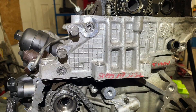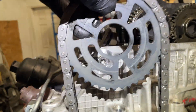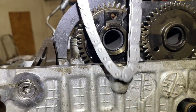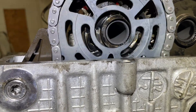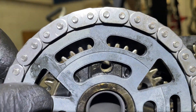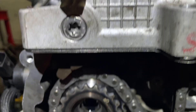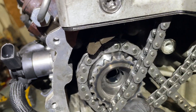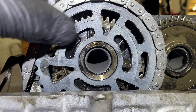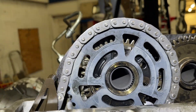When it comes to putting this top sprocket on, make sure that these long groove areas where the bolts go through are in the middle of the hole, because later on you're going to adjust this slightly — you want adjustment on both sides. Put that on and loop it around the sprocket on the fuel pump, then play with the position by moving it until the holes are all in the middle of these grooves.